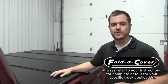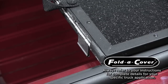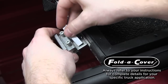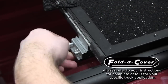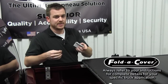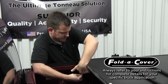Now that we have the cover on the truck, it's time to secure the cover to the truck bed. We're going to begin by opening up the front panel and attaching the hinge bracket. Simply slide the hinge bracket over the hinge, ensuring that the allen bolts are facing the front of the truck bed. Place your shim, pushing down firmly so that it's fully seated, and then finger tighten your allen bolts. Now that both hinge brackets are installed, it's time to install the C-clamps. Simply take your C-clamp, place it underneath the bed rail, and attach it to the hinge bracket with two bolts from underneath.